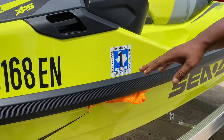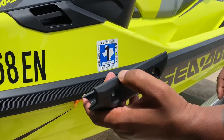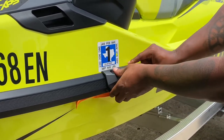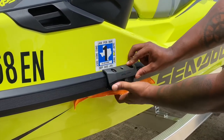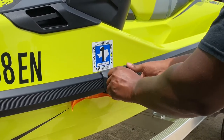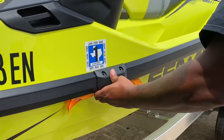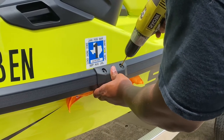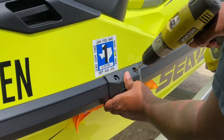I'm going to go ahead and get started and show you how it goes. You want to get your fender and get the orientation right — we want it right about here near the speaker. Slide it back to position it, hold it on, find your holes, and mark them so you know where you're drilling.